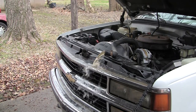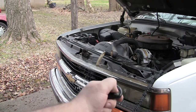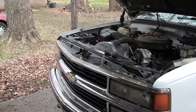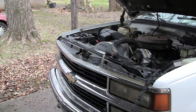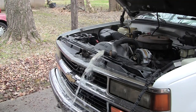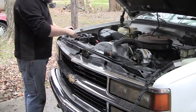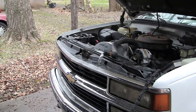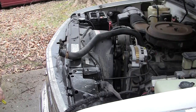You can see it gets a little dark again. And there's a surge of water, and then the surge quits — so that's when I shut the truck back off and let it fill back up. I do this about four or five times. And I took the cap off to let it flow out the top of the radiator to flush it that way.